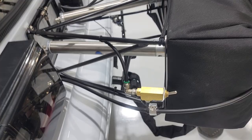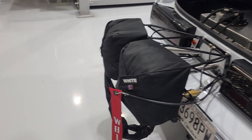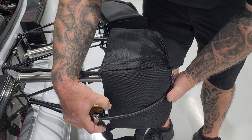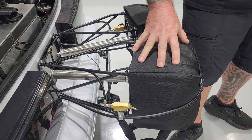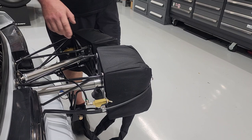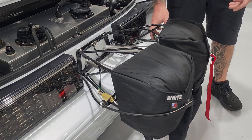I'll put the safety lock pin on one of these chutes and we're going to hit the other chute with 200 psi. I'm going to turn the bottle on quick. Right now the chute's not charged. These air valves are what charges the chute - I've never launched these before, so I don't know what's going to happen. When you turn this air valve on, the chute's now charged - pressurized up. We're applying 200 psi to this cylinder and it's loaded. When you pull the chute handle or have the ECU pull it, this is going to pull out and launch the chute. This one has the safety pin in so it'll pull the cable but not actually deploy the chute, and it's not charged.